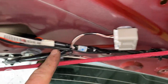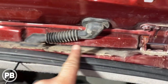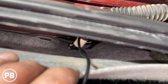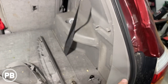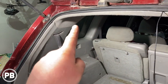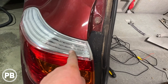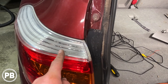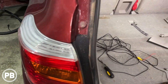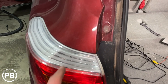This is our video wire, which also includes the power wire built in. It goes all the way down, through that access port — you saw us fish the wire through. We're almost in the center so we could go left or right; we'll probably go on the driver side and work our way forward. We also need to grab power for our trigger wire — we have to run a separate wire and grab power off the positive wire of the reverse light. We'll run that wire all the way up to the radio, and that's going to trigger the radio to go into reverse as soon as that light turns on.